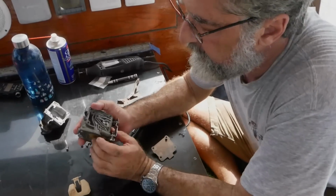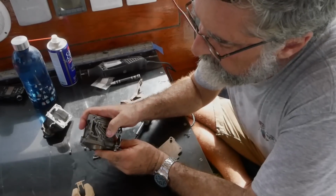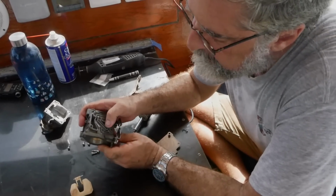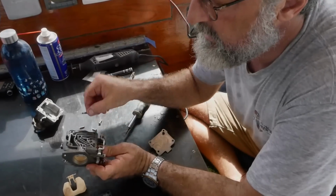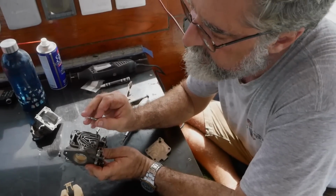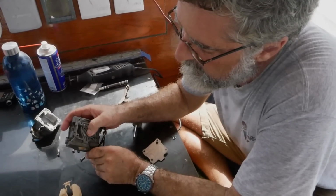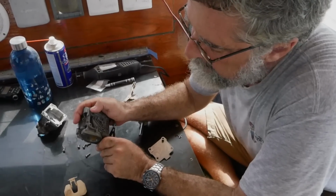And when the throttle plate here is all the way closed, the only real opportunity for the fuel is to go, I think, way up in the front here. And that's metered and controlled with this needle valve. So that part in there has to be scrupulously clean, and that's the smallest passage, and that gets plugged up real easy. And then as you give it more throttle, these little other holes start coming into play.